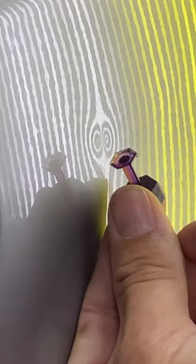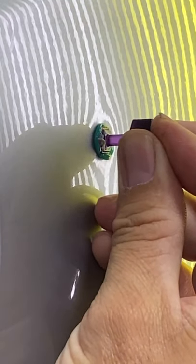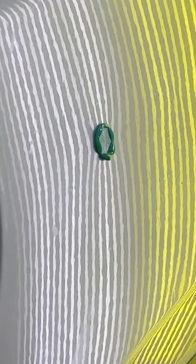Tech tip: when you do glue pulling, have a system where you put stuff constantly in the same spot. If you want to put it on the panel, leave it on the panel — do it every time so you're not looking for your stuff constantly. We're going to go with the tequila glue again. I do not wait very long and I push it pretty hard. One thousand, one thousand two — set this up, get that in the middle, a little tension, one, two, three. Good pull.